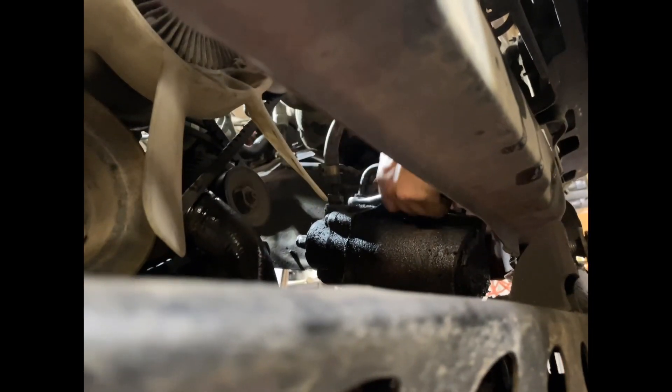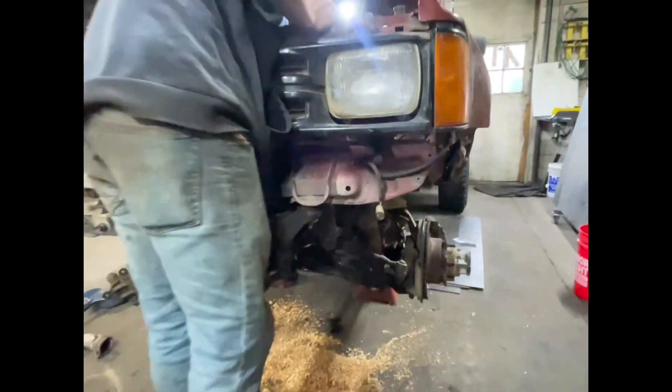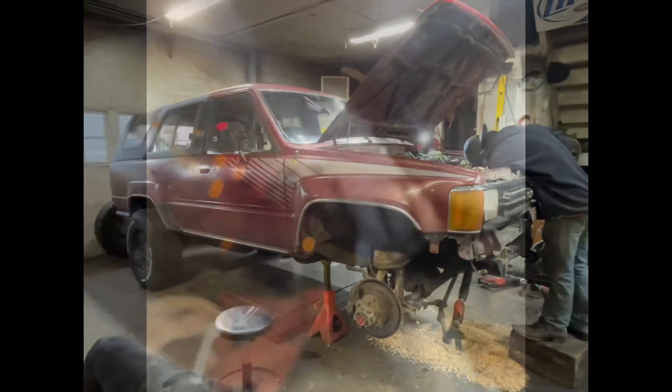You'll remove the line, which our helper is right now doing as you can see right here. He's using the line wrench as he should and he's slowly getting them taken off. Then he's going to pull his final bolt for the steering box and he'll pop that off, because he already cut the steering arm off which we don't need. Then we'll get to unbolting more things from this 4Runner.